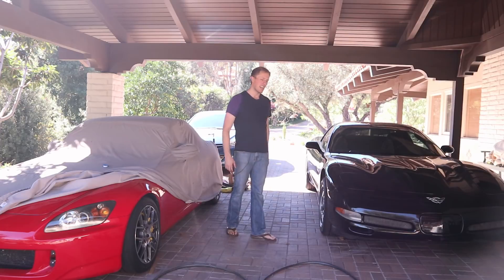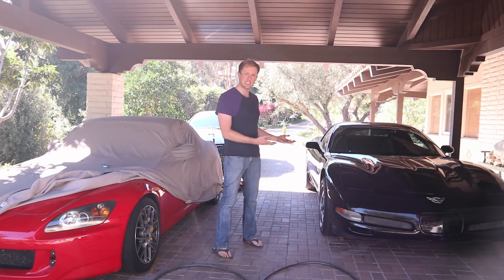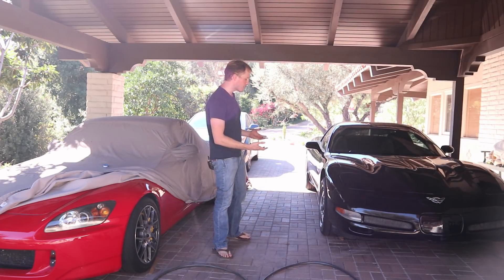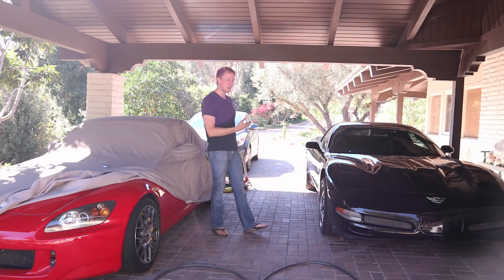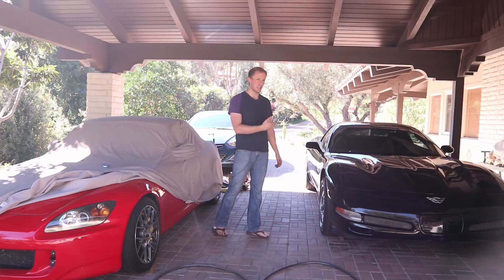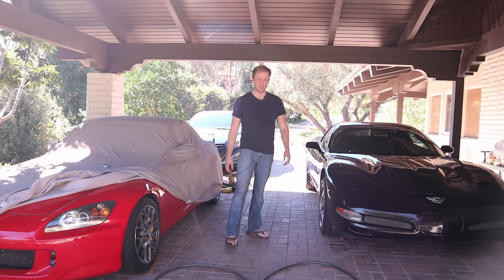With the C5-Z06 I have had excellent luck taking this car out to the track in stock form. The brakes are very good on this car. You do have to watch out for pad taper with these calipers, but the rotors are huge. I can upgrade this car to two-piece rotors and keep the stock calipers, which saves me a ton of money. So right away we have an advantage with the Z06 — it comes with better brakes from the factory.